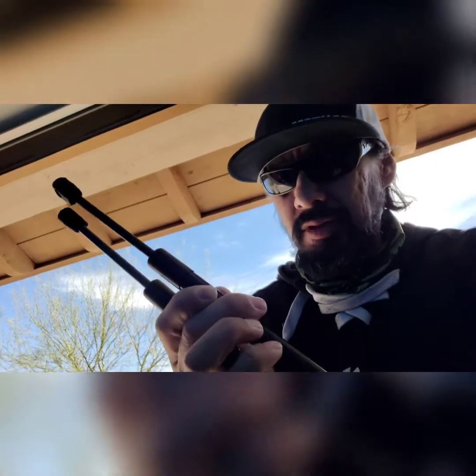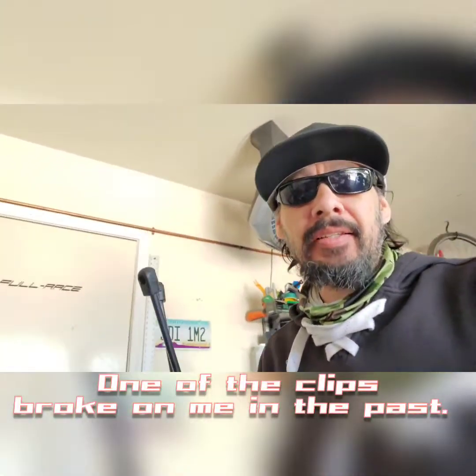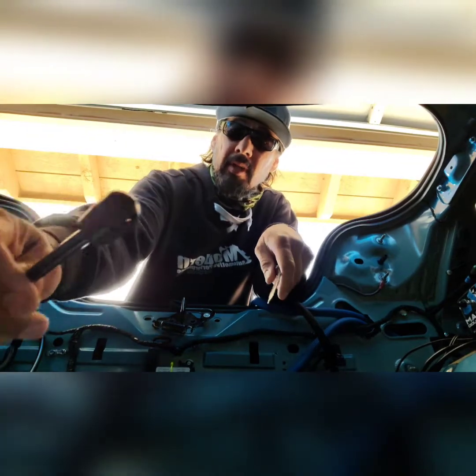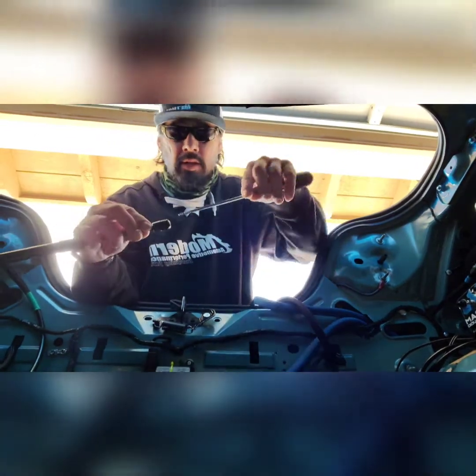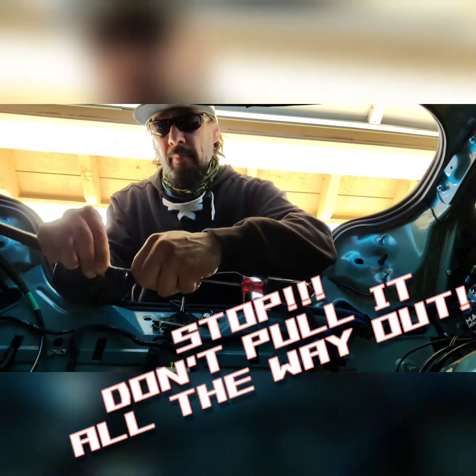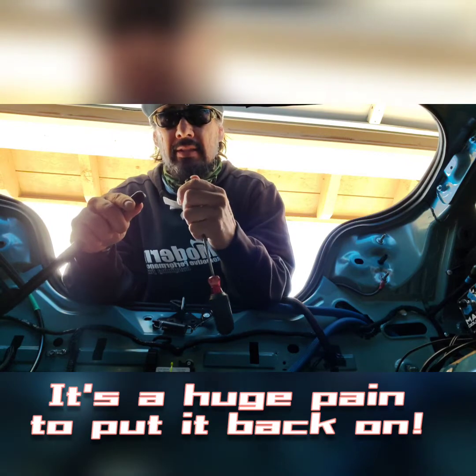So these are it — this is a pretty simple install job. The only reason I'm making a video is when you are taking off the little thing that clips in and out, if you're not careful those things will pop, they'll either break or they'll go flying. So let's get started. Here's that clip I'm talking about — what you want to do is get a small flat head, go into the little groove, pop it up, and grab it with your thumb. The reason you want to do that is because these things will go flying.